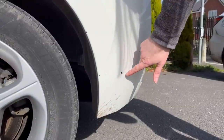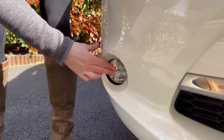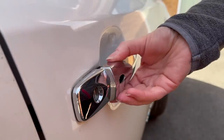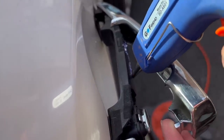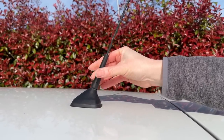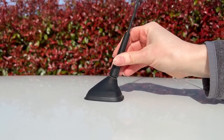I'll take a walk around the car looking for damage. As you can see here the offside front fog lamp is insecure. This is common and normally an easy fix. Check both mirrors are secure and also the door chromes. This is another common issue on the Leaf but nothing that can't be sorted with a hot glue gun.